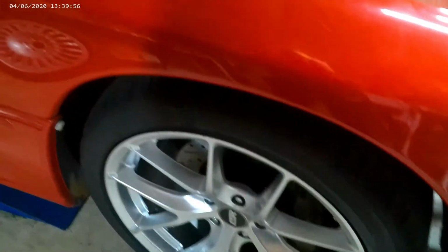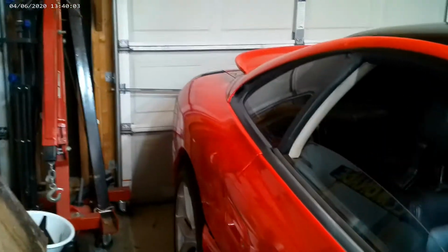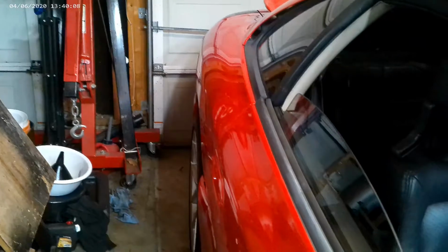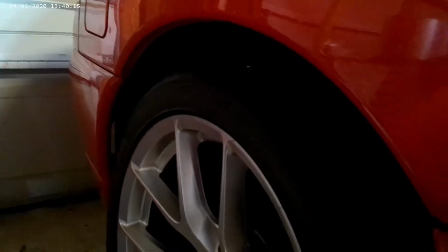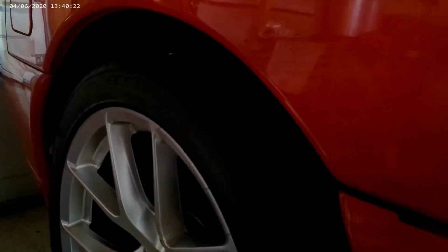They're plus 30 up front offset, and they sit perfectly flush. The rears are 9.5 inch. They're plus 35, which kind of barely, maybe tiny poke out a little. Yeah, I don't know. They look pretty awesome too. They are 275/35/19. So they've got some meat to them also. They fit perfect. I could actually go, I don't know, I could go with a 10 or 10.5 inch wheel with 295s on it. I bet I got a lot of clearance there.